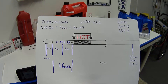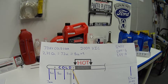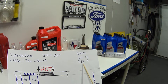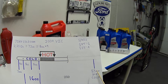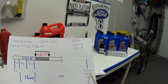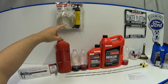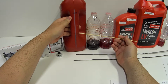I wanted to do a simulated cold check and see what the minimum and maximum of that cold check mark is. I did this on my 2004 Crown Vic just a couple of days ago, on May 4th. My garage temperature was 64 degrees and outside temperature was 55 degrees Fahrenheit. The first thing I did was measure the fluid with the engine off — the fluid was halfway up the stick, about 53 millimeters above the cold dot. Then I took my fluid pump and sucked all the fluid out of the filler tube as much as I could, pumping it right into an empty container.